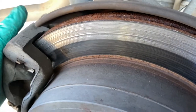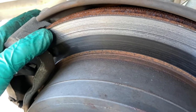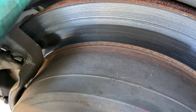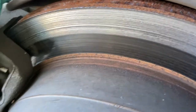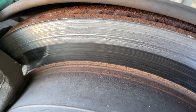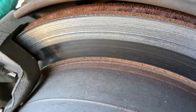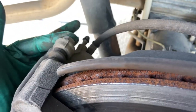First step: take your wheel off. We are due for brakes — the pad was actually wearing into the rotor. I'm filming the passenger side rear because this is the worst. Wear indicators did not go off; unfortunately we dug into the rotor. I wanted to change the rotors anyway when I did this brake job, and I can feel wobble when I apply my brakes.